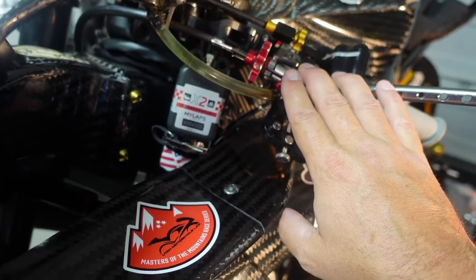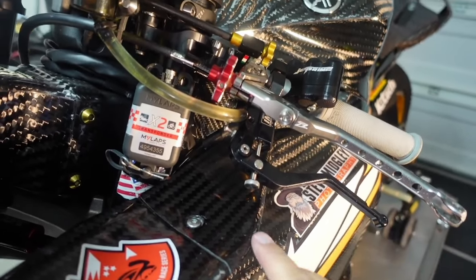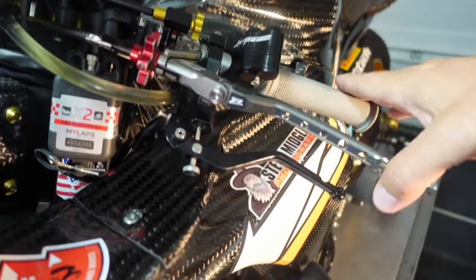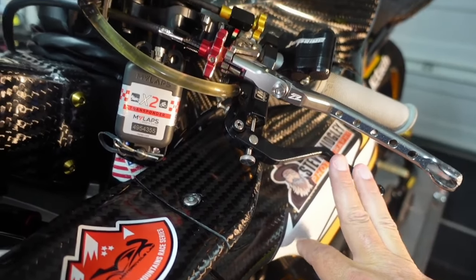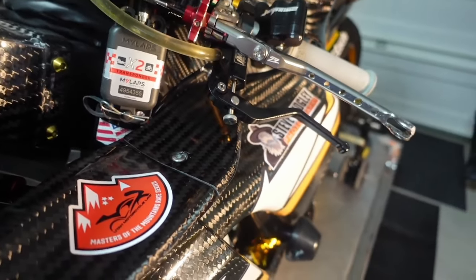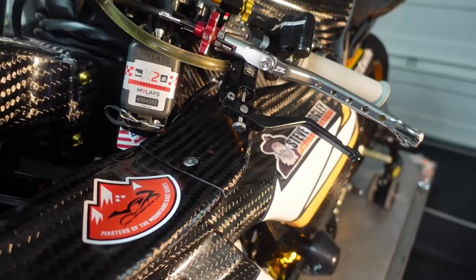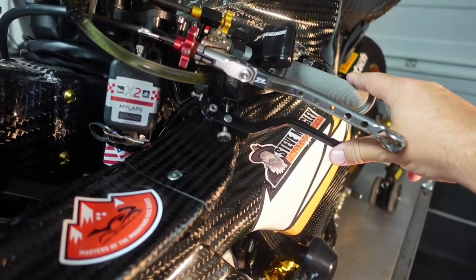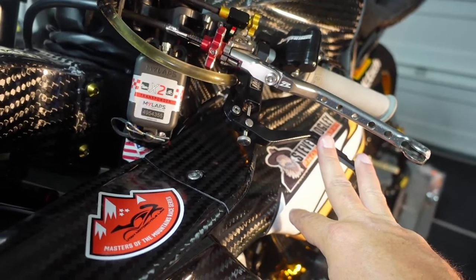I hate this Zeta clutch lever — it's been damaged and is the only one I have. It'll end up going away and I'll go with a Gale Speed perch for the wire clutch. The only reason I haven't done it is money — the Gale Speed is about $300 for the clutch perch. As for why put the rear brake on the handlebar even if you're not racing: if you're braking into a right-hand turn using both brakes, you have less room for your foot. With this setup I can trail brake into a right-hand turn without adjusting my right foot at all.